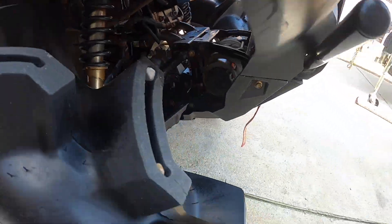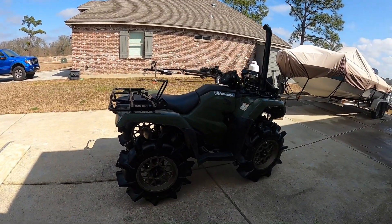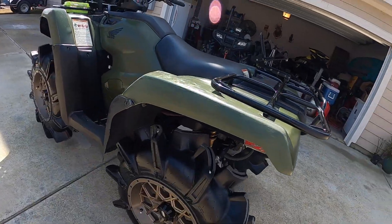I did have some kind of knocking and grinding noise going on in the front end. I went for a little ride last weekend around back there and it never made the noise again, so I think it was just from being stupid in that hole in my last video - I shouldn't have done that. When I drained the fluid it was just a bunch of sludge, not good. But she's doing good right now - I changed the diffs about three times in the front to flush it out, and the rear diff is crystal clean still.